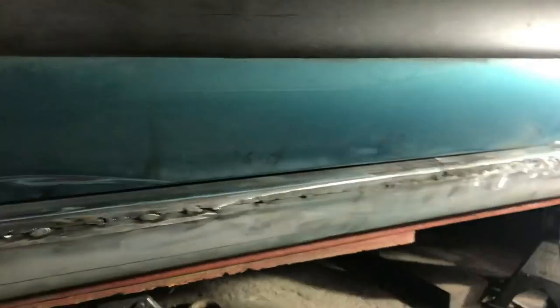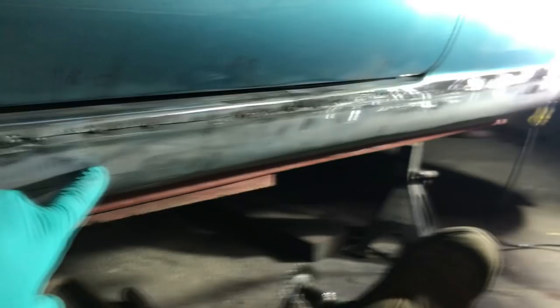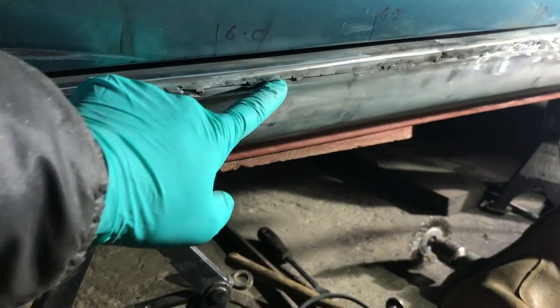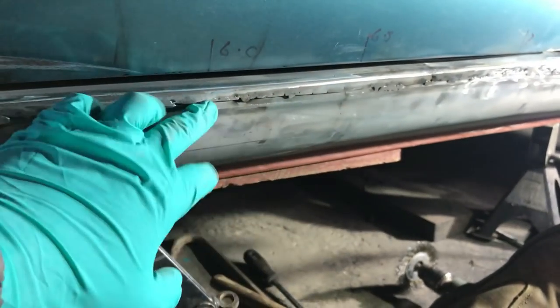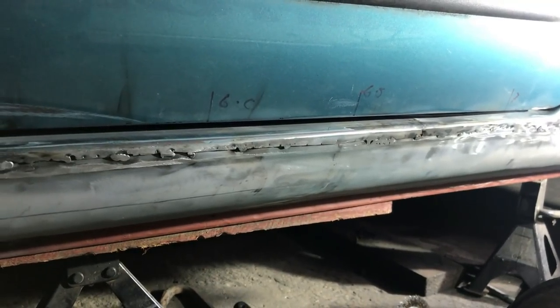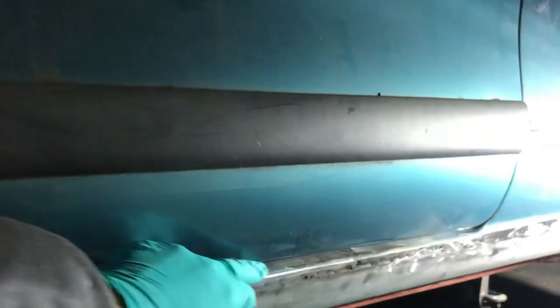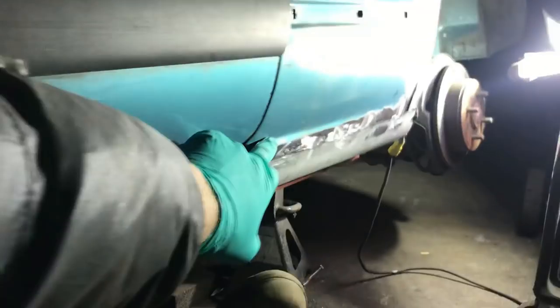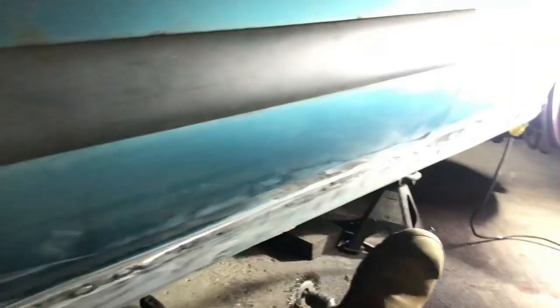I'm about probably halfway through now and I've just cleaned off some of my welds. I'd love to say this was beautiful picture perfect welding but it ain't, because I've still got the problem where that is relatively thick nice clean metal, this is thinner and hanging in free air - it's just an edge and lip - whereas behind is a nice flat panel. So every time you try and weld it, it just burns that back and you don't get enough penetration. It's been a real pain trying to get the welder set up. You can just see here where I've peened with a hammer to make better contact. Crucially everything's in the right place - I've still got my detail line running through there, there's no warping to that panel, and the line of the sill looks really good.